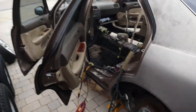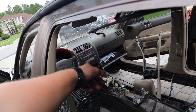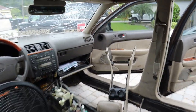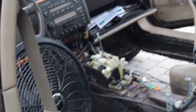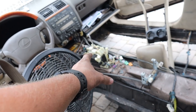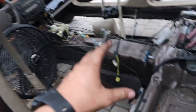Fast forward about half an hour - you saw me start taking apart the center console area. It was pretty tricky; it's held in by tabs up by the glove box and under the steering wheel dash area. I ended up just yanking it out. For those interested, there are a couple screws - it's really not hard. The wood piece in the middle just needs a tiny screwdriver to slowly work up the sides and it pops straight out.